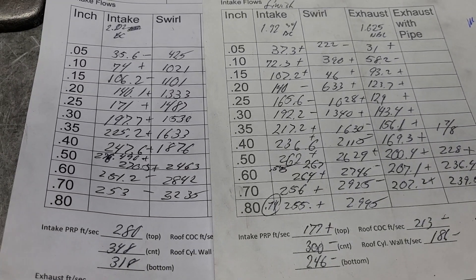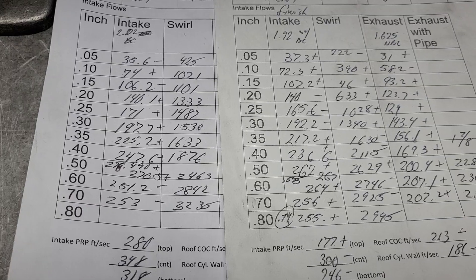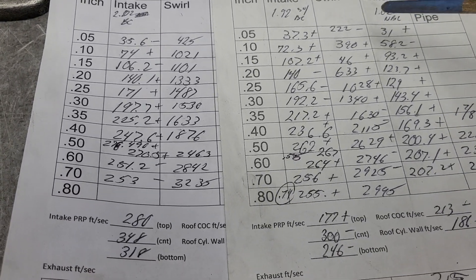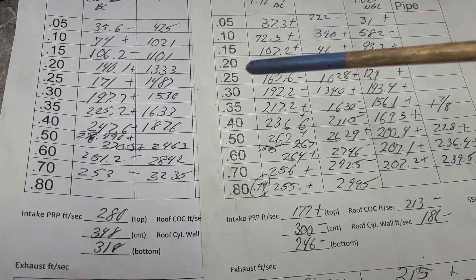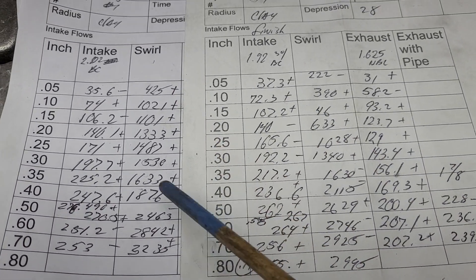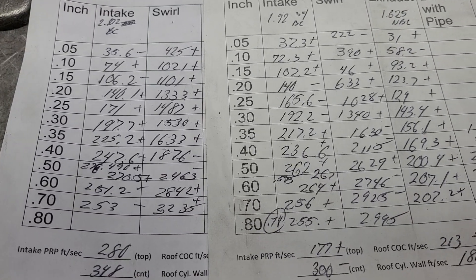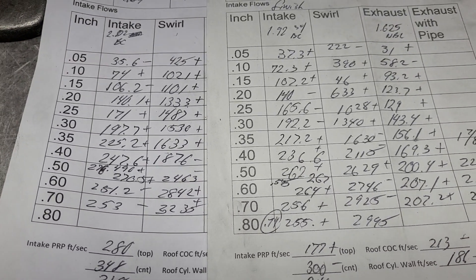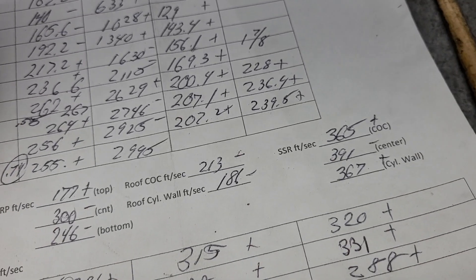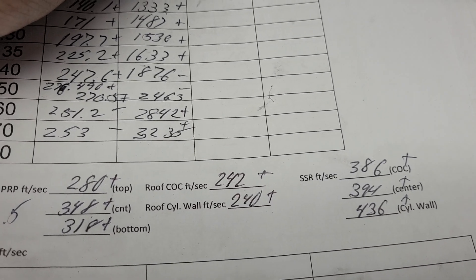But it's not a super high RPM engine either, so I think it's really good for what it is. If you think it's not going to do what it needs to do, let me know in the comments. Now let's compare the swirls. These pluses and minuses are in reference to the swirls — almost all pluses. The bigger valve changes how the air exits into the chamber, so it will change your swirl. Now our air speeds are all up, and it's also moving more air.